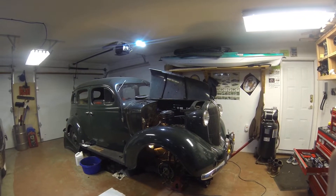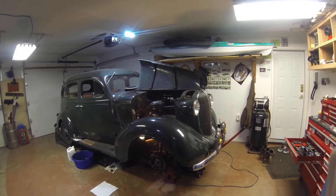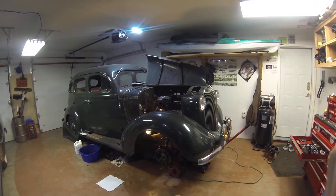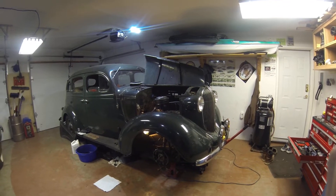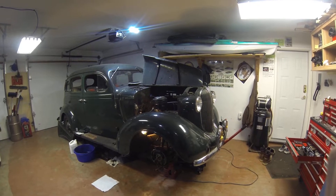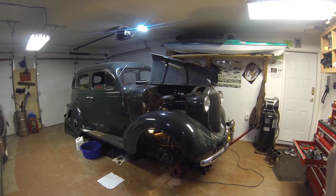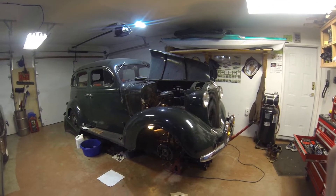I'm walking through some of this stuff for beginners. This is a good idea to decide what type of oil you're going to run in these cars. In one of my earlier videos called 'Introduction to Flathead Engines,' I talked about the differences between modern detergent oils and older non-detergent oils. An older non-detergent oil can leave a lot of sludge in your oil pan, oil galleries, and in the valve cover area on these old flathead engines. It's a good idea to clean that area out before you put in any modern oil — it'll break down the sludge.